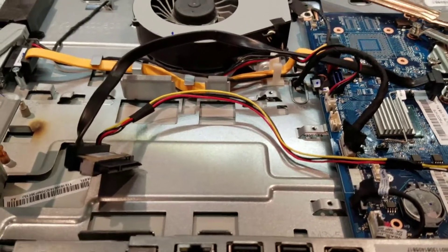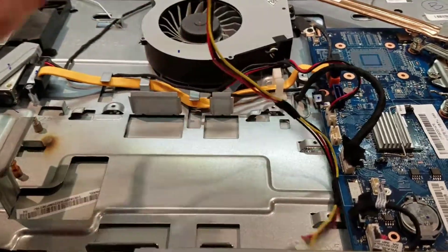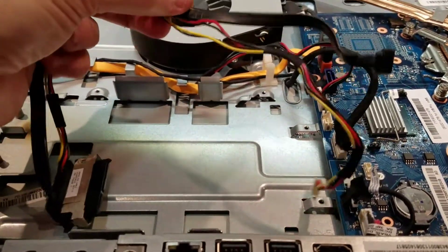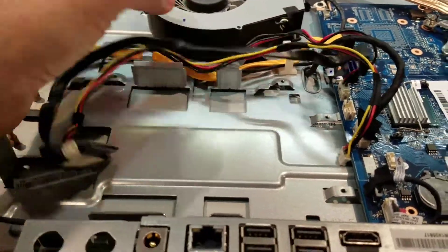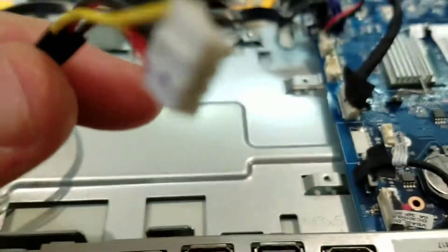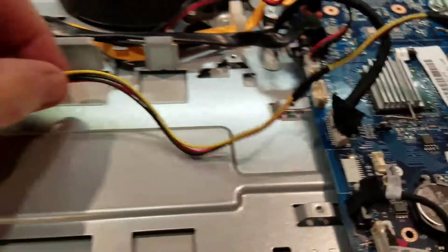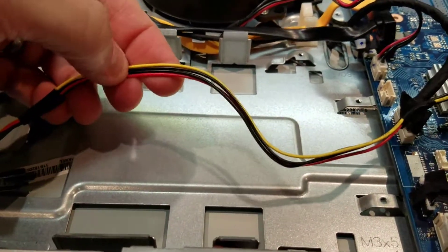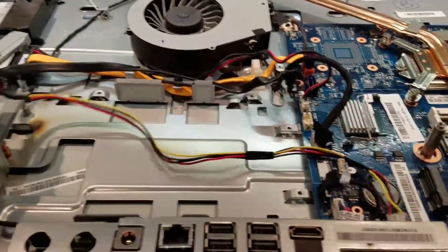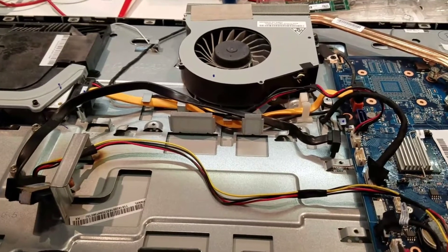This DIY repair will cost about $5 to fix both units, instead of buying two replacement cable assemblies at $15 to $25 each — that's $30 to $50 total. Based on your skill level and willingness, you can save money and probably get a longer-lasting repair by making your own cable. Just remember to save the motherboard-side power connector from the old cable. When you get a regular SATA power cable, just solder matching wire colors together, make sure everything is insulated and tight, and you're done.